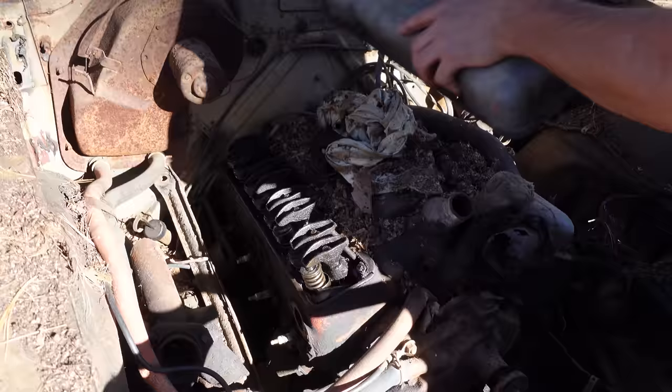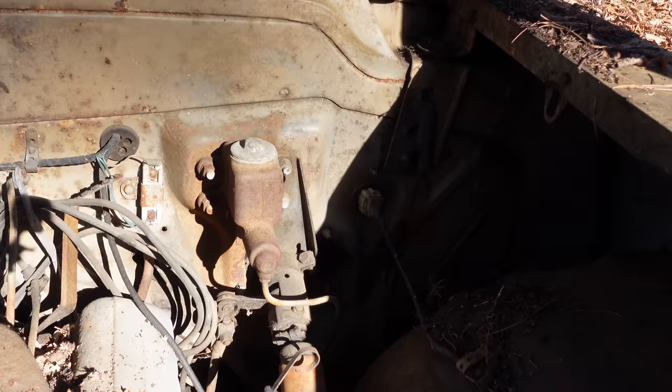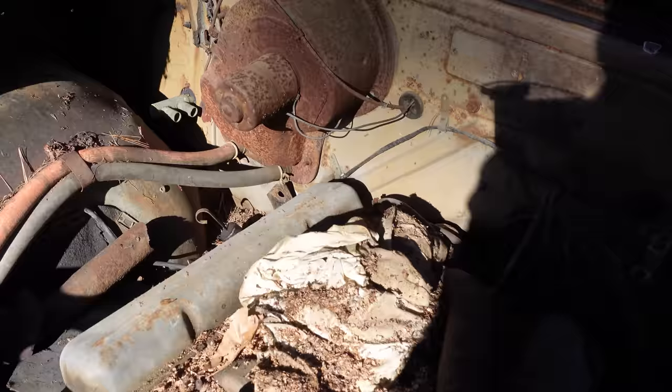We see on this one manual steering and manual drum brakes. There's that weird cast iron master cylinder right here with the screw on top — you'd use a wrench for that. And the dipstick right here. We do see some linkage; this is probably a three-speed manual. Oh, no — it's a Powerglide. We go to the passenger side, that dipstick down there. Okay, Powerglide time. If you know how to add up the clues, you can learn a lot about a car without even looking inside.